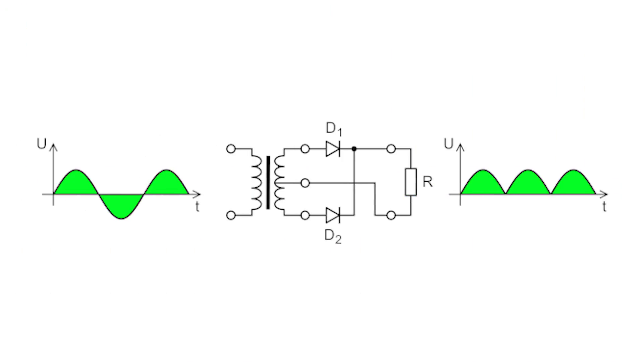With the base station, you're going to create an alternating current — it's not just going to be flowing in one direction, it's going to go back and forth — which in turn creates an alternating magnetic field, which is a changing magnetic field. So if you take that coil of wire attached to the phone and put it near that base station, which is creating that alternating magnetic field, it's going to start inducing a current into that coil, which goes into the phone without even touching it. Then there's circuitry that converts that AC into DC, and now you have a DC current going into the phone, just as if it was coming off the wall.